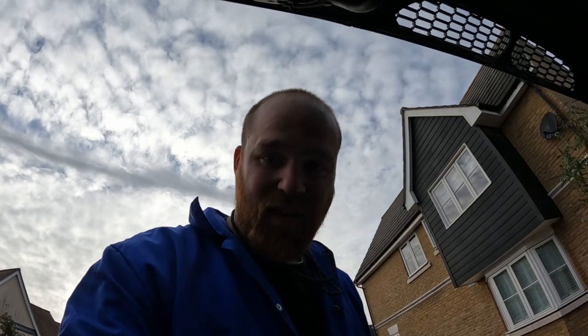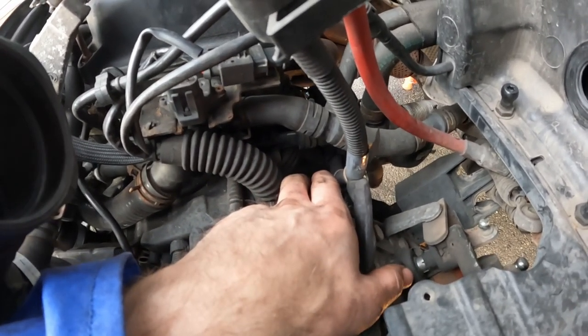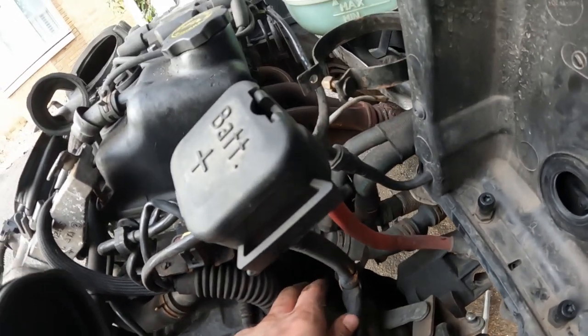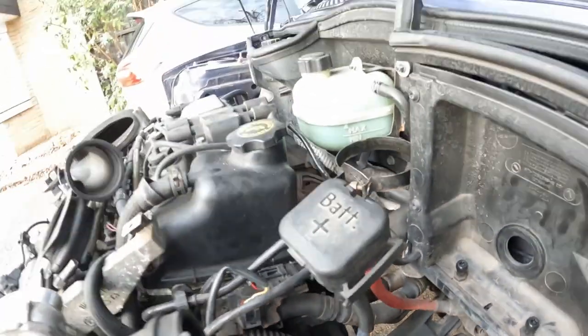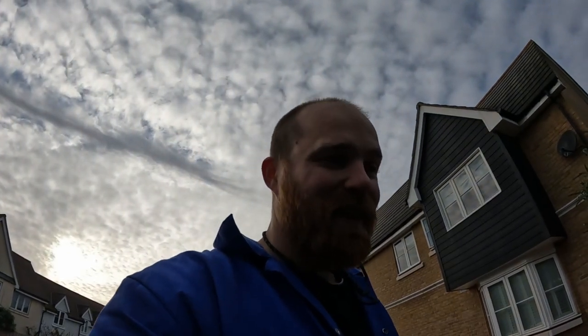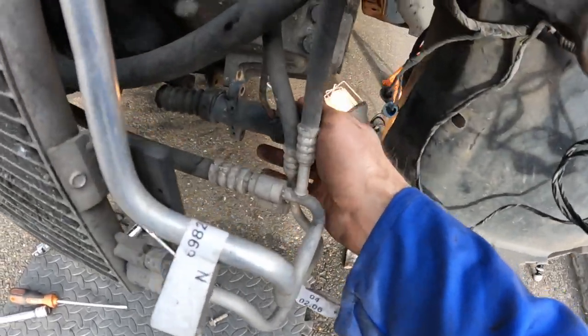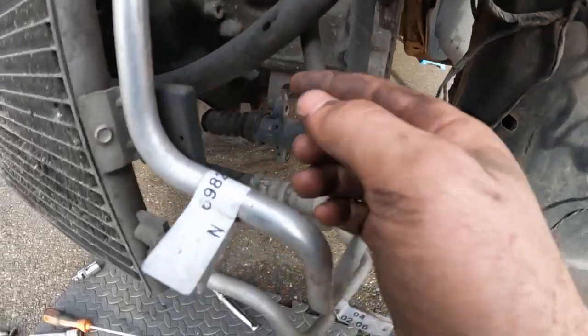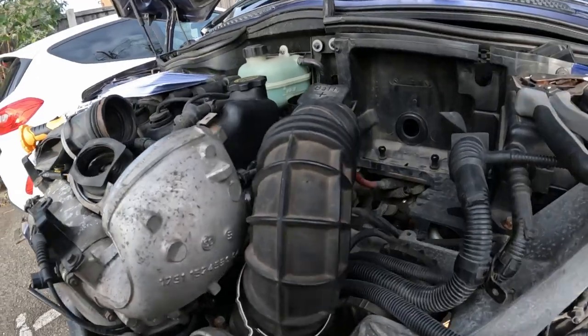There's a lot of oil on that starter motor. I'm now taking out the bell housing bolts, and I've come to the trickiest one — all the way down in there — and the bolt isn't actually in there, it's already missing. So somebody has changed the clutch at some point and just couldn't be bothered to put that bolt back in because it's a bit tricky. There's probably someone watching who worked on this car! Okay, I've taken the slave cylinder off and I think I've got all the bell housing bolts out.